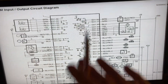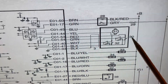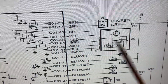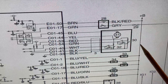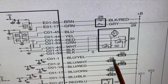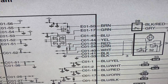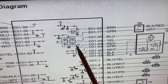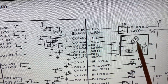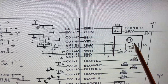Don't get overwhelmed by this schematic — we're just going to strip it down to basics. A week or two ago we touched on the position sensing of the electronic throttle body; the whole assembly is item 30, the motor being item 31, which is what we're focusing on in this video. There are two separate wires going to it, driven via this H-bridge circuit — solid-state switching that toggles polarity for open or closed, and duty-cycle controls the rate at which the throttle plate moves.